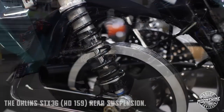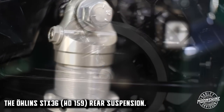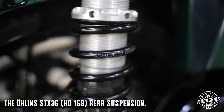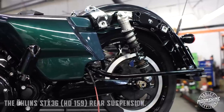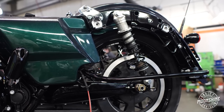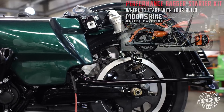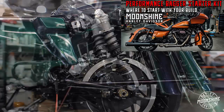These are a pair of Öhlins 13-inch shocks — the HD 159s. They are what they call their DRL, which is for divided piston shock: rebound and length adjustment. The difference between the DRL Öhlins and their top-shelf shocks would be the remote reservoirs — we run the 357s and the 044s depending on where we mount the reservoir. We went over that in the first performance bagger video, so click the link on screen.